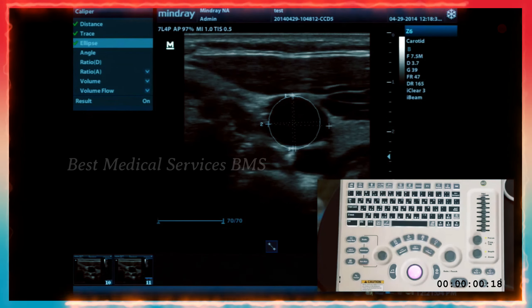If you want to pick up and move a word, use the trackball. Once it turns green when you hover over it, use the set key to pick it up and move it wherever you want. If you want to add another annotation, select it and it will place it where you dropped the previous word. To get rid of letters that don't make sense, click the set button, then hit the clear button just below the ABC comment key — that'll remove those unwanted letters. Hitting clear again will delete other text on the screen.